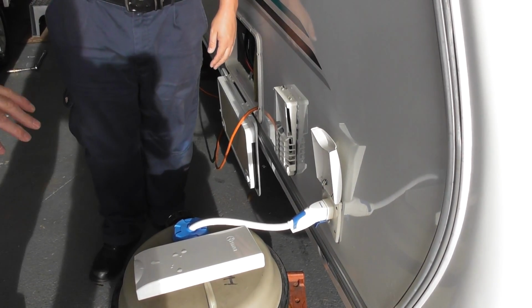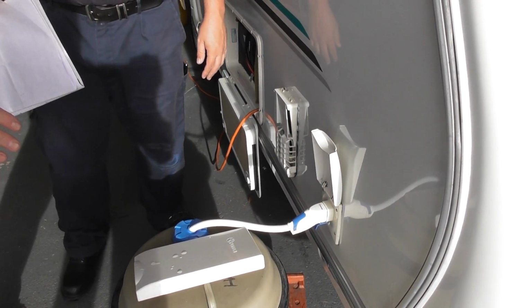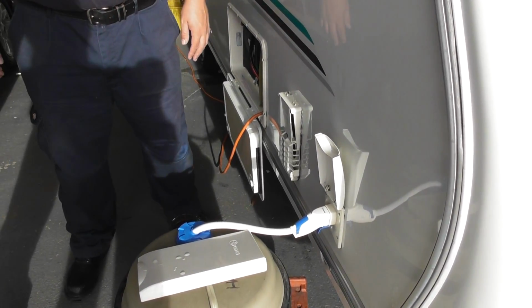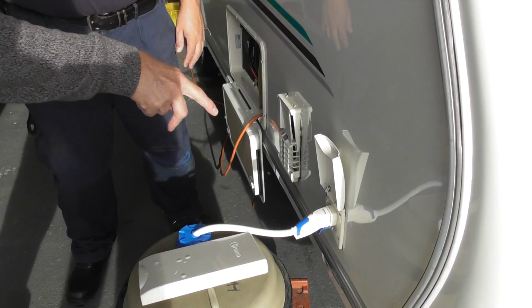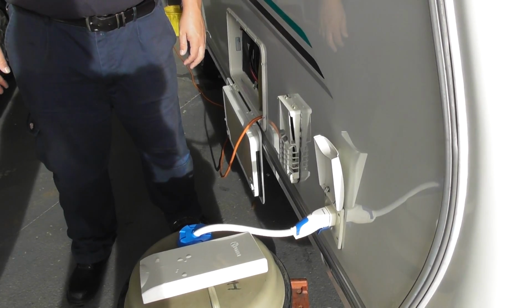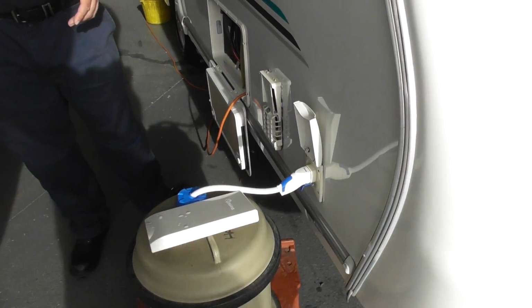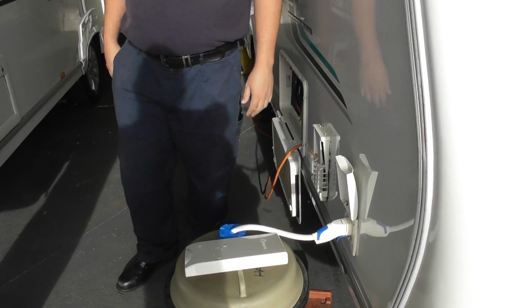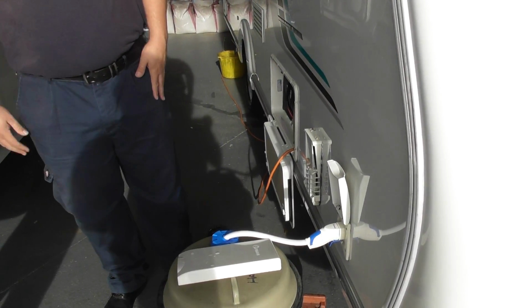Right, now I'm going to give a hypothetical situation. We've got a barrel that's empty. We go to the side tap, fill the barrel, bring it back and hook up there once we're static. Yeah, once you're static in place. And then obviously when you run out of water, all you need to do is pull it through the taps just to make sure that you've got all the air out of the system.